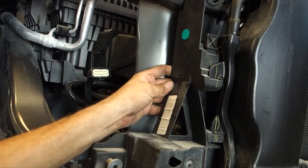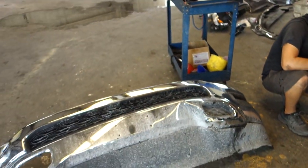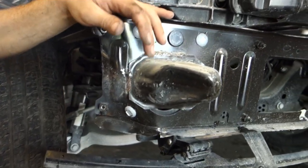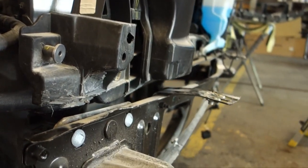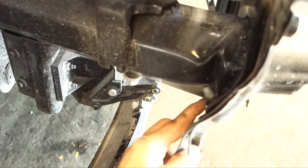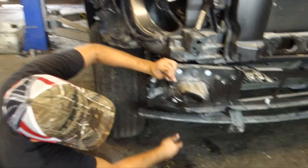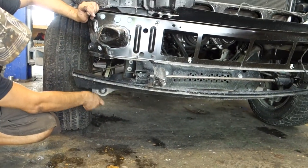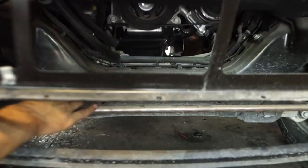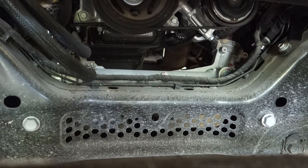We've got the radiator support that's cracked a little bit. Then the biggest thing - I had to pull off just the chrome part by itself, and when I pulled it off you can see it got hit right here, right in the reinforcement. If we come back here, you can see that the front rail buckled. That's the reason I took just the chrome off by itself, because I couldn't get to that bolt right there. We got a nice little buckle there - we're going to try fixing that. And here's that power deflector again - it's kind of unique, I haven't seen that before. And then we haven't seen before the Swiss cheese in the front crossmember - I'm guessing that's for air to go and cool something off.